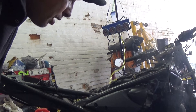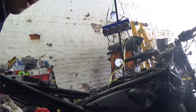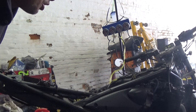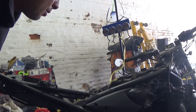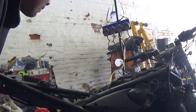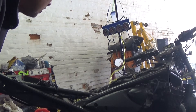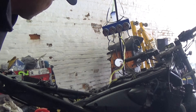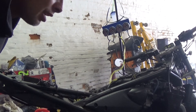She fired up. Something's going on with my gauges to sync the carbs - I've got to mess with that. But right now it fired up for the first time since I've rebuilt it. I see a lot of smoke coming off right now - it's from oil on my hands, fresh paint and stuff like that, so I'm going to let that burn off. I'll mess with my gauges to see if I can get them to work so I can actually sync the carbs. For some reason they were working and then they stopped. They are cheap ones, so I'm going to see if I can get those to work. I'll be back once I get that sorted and we start actually syncing the carbs.